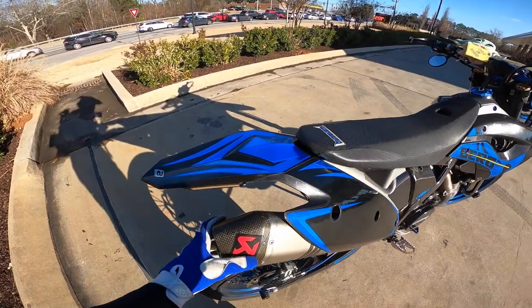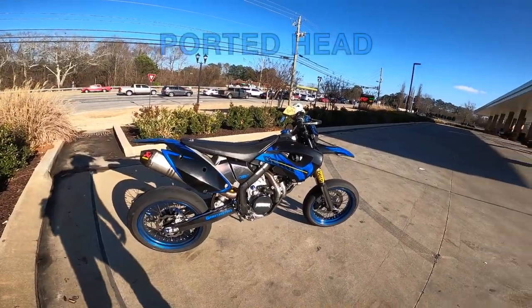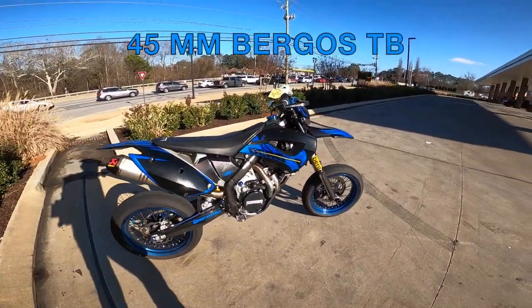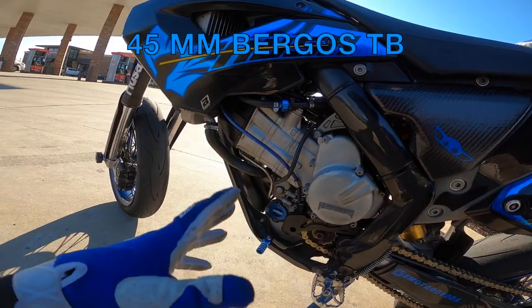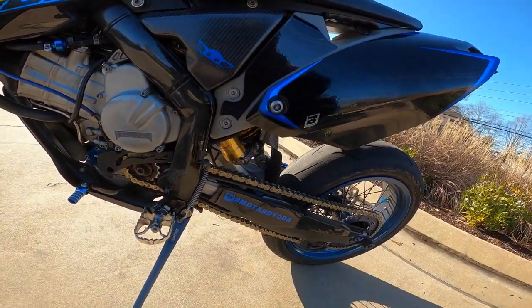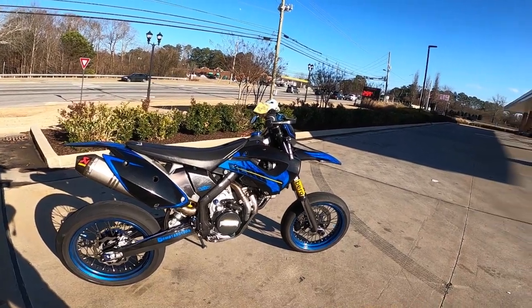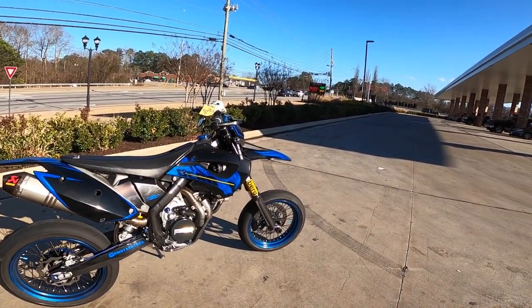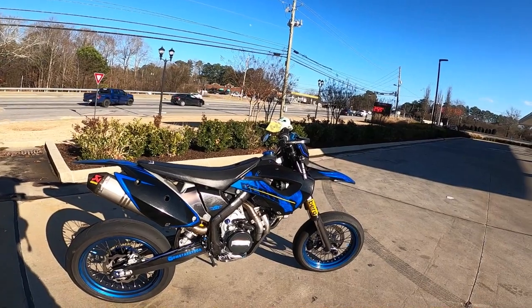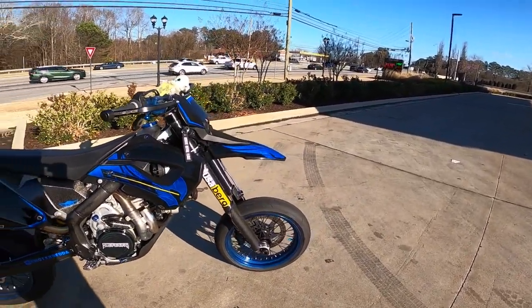Akrapovic pipes - I've not seen any for sale and I'd be interested in getting a backup. Motor-wise, you can see it is a 70-degree - the head is ported, it's running the big 45mm throttle body. We've got a friction-reducing treatment that the engine block underwent and I think it legitimately works. She still has not a lot of miles on this build - I'm going to say less than 2500. She's not a new bike but the motor is essentially new. I think the total miles is maybe a little over 4000, but again the motor has been rebuilt.